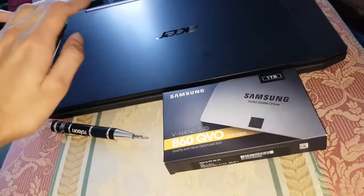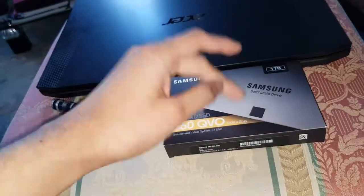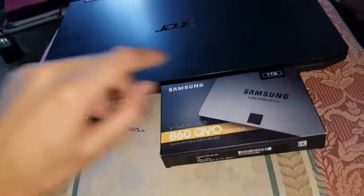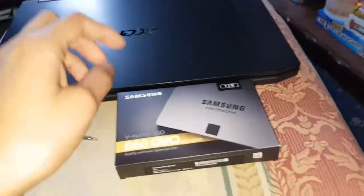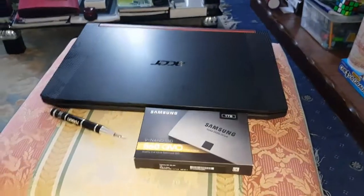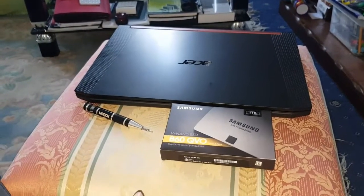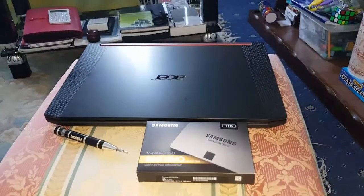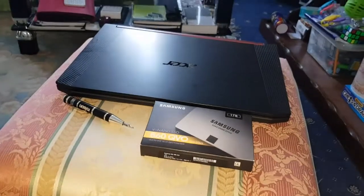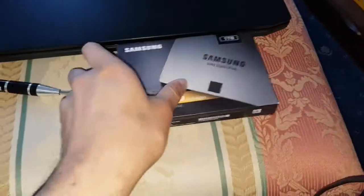Now these ones have already started getting full up because I've put all my games on them, so this is necessary at the moment, so that's good. And I don't plan to fill up all of them. I'm going to leave about 100 gigs on each one spare, just for over provisioning and for performance. On the Crucial one, the performance goes crap once you start filling up. The Samsung one's okay, so on the Crucial one, I'm definitely going to leave about 100 gig free or somewhere near that. On the Samsung one, I'll fill up a bit more, maybe 80, 60, 70 gigs free. And then this one, same. Samsung is pretty good with this kind of stuff. They don't slow down as much as you fill up.